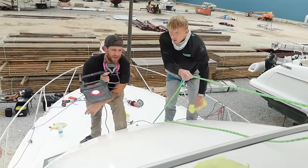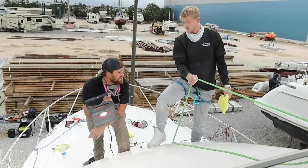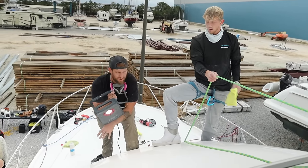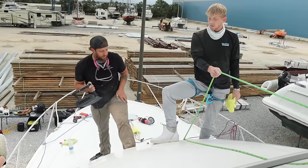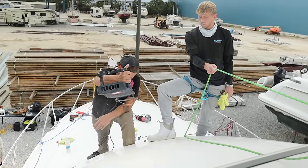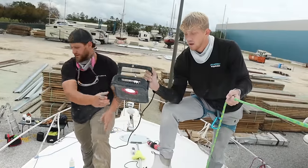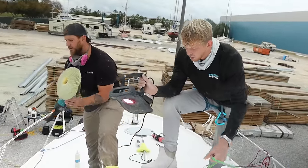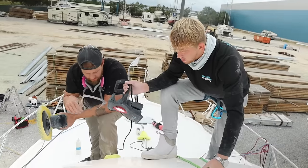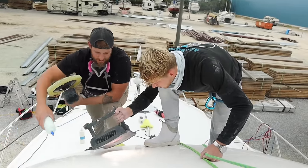Even if you wax it, it'll look really good for about a month or two on that sanding. When the oils from the compounds start to go and then the wax goes, it'll look like oxidation — but really it's just a sanding scratch coming through because it's still scuffed. Let me look at what's underneath it. Hand me the chop top — you may not even be able to see it.